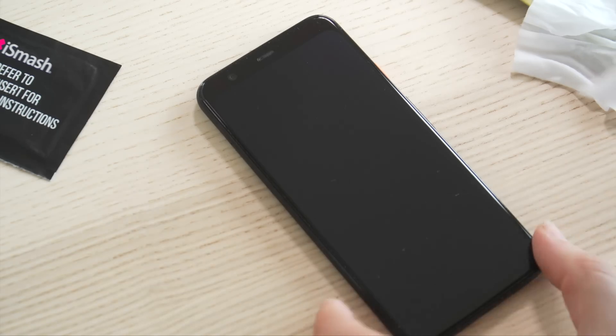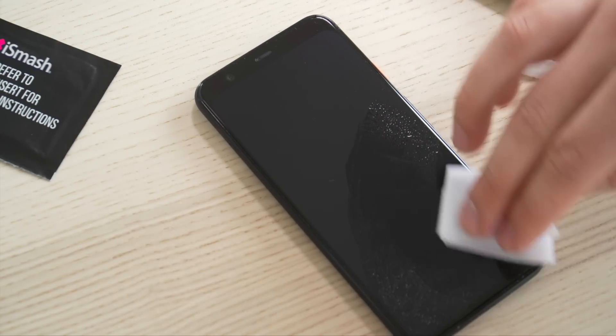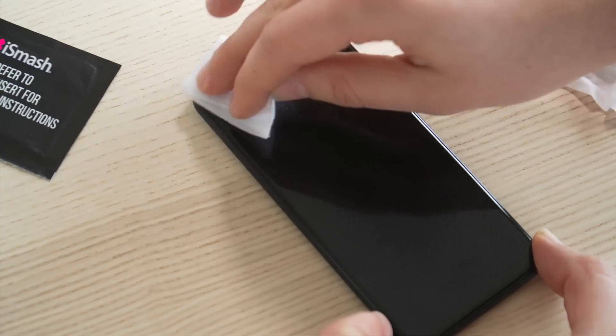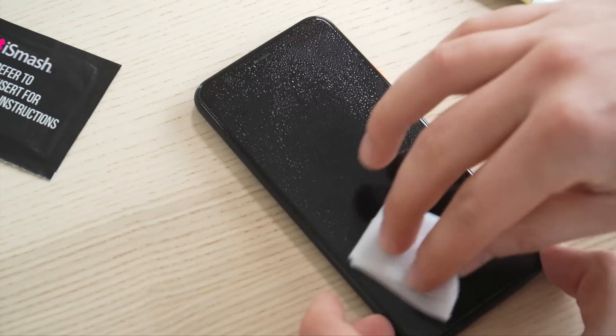Finally, what can you do if, like me, you've stripped the oil-repelling coating off your phone's screen? Well, there are some ways to fix it. First of all, you can get a screen replacement, although that's not going to be the cheapest option. Or you could stick on one of those glass screen protectors, which is a quick and easy way to fix the screen. Or you could try this — it's called Liquid Nano, and this wipe puts a silica dioxide coating over the display that the company says will restore the oleophobic properties for 12 months. It costs between £20 and £40, and you have to let it set on the phone for at least half an hour.